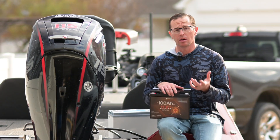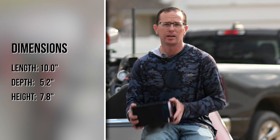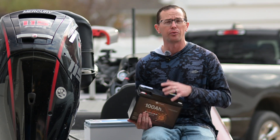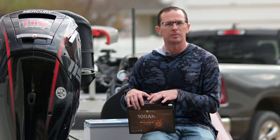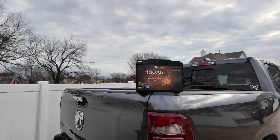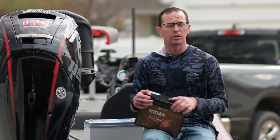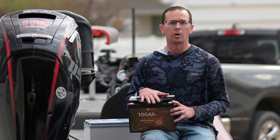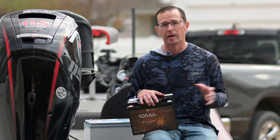The overall size of the battery is 10 inches wide, 5.2 inches deep, and 7.8 inches tall — very small, just over 400 cubic inches. You really want to look at that volumetric space when comparing a mini battery to make sure you're getting the tightest package, especially if you're size-sensitive like in a kayak or squeezing a battery into a rod locker. Keep in mind that 'mini' isn't a standard like group 24 or group 31 — mini is just whatever the manufacturer considers small.